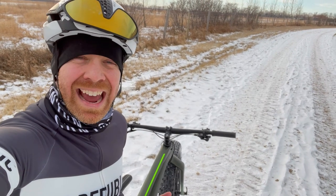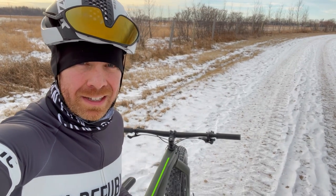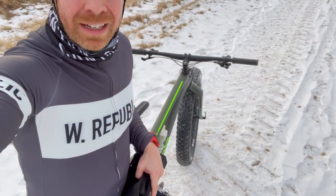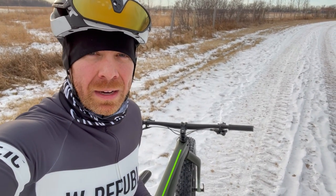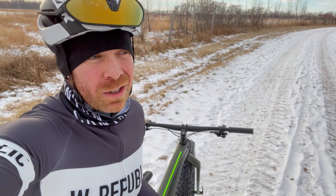Now to make the ride quality extra good, one of the best things you can do for mountain bikes, gravel bikes, and especially fat bikes is make the wheels and tires tubeless — take the tube out and fill it with sealant. The reason that makes such a big difference with big tires like this is because rolling weight is amplified by about four times. In the case of these tubes, which weigh like a pound to two pounds each, you're talking about performance gains equivalent to removing eight to sixteen or even twenty pounds, depending on how big your tires are. So that's almost a must, and the change maybe costs you 60 bucks.